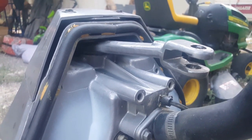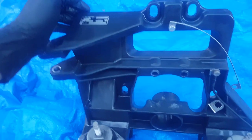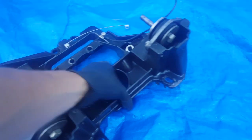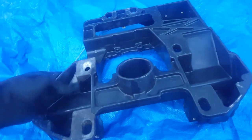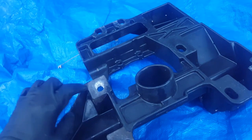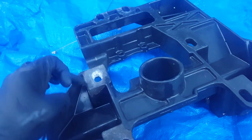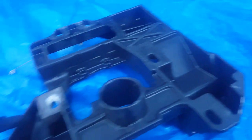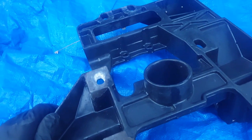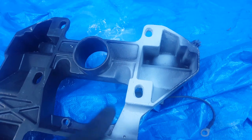Let's take a look at the transom plate as we're about to install this into the boat. One of the things you want to do is go through and degrease everything - the area around where the shaft comes through is prone to have a lot of grease in there. Where the zinc is connected we had a little bit of corrosion, so get all that out with a good stainless steel wire brush, then recoat. The outer coating from the factory is chipped off here where all the grounding takes place, so take your wire brush and recoat that area to make sure you get good contact.